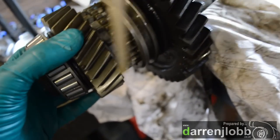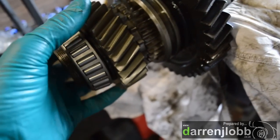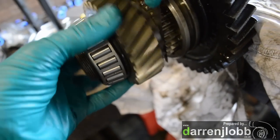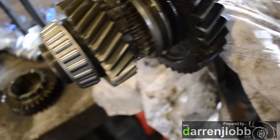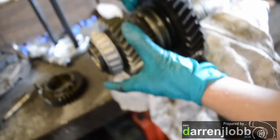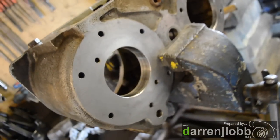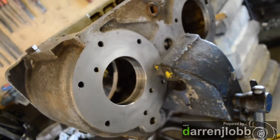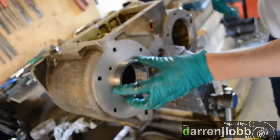So we've got a 0.1 mm feeler gauge, and we've just got a snug fit on that feeler gauge — just sort of tightish. But you can feel once you get the feeler gauge out, you've just got a little bit of movement, which will enable you to move that shifter around. We've just driven the race out of the housing — which is where those bearings seat — so we're going to drive new races in to match the new bearings and then drop that back in.